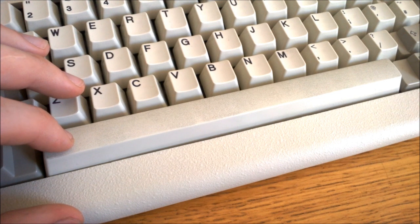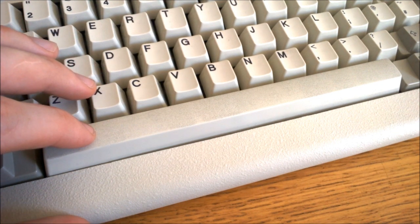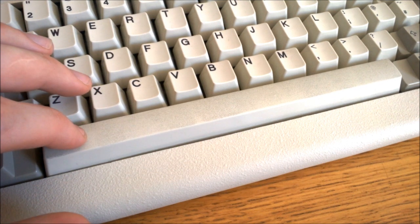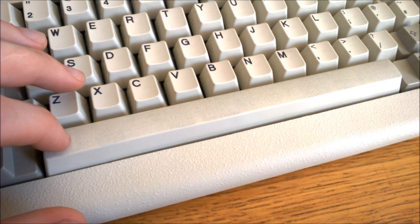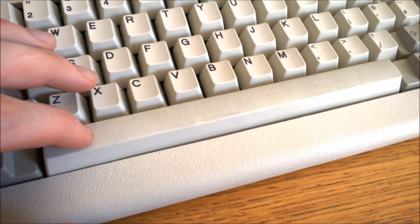One well-known issue with this keyboard is that the stabilizer on the spacebar, the only stabilizer in the board I might add, adds a lot of force needed to press the switch, so the spacebar is very stiff. You can bend it outwards a little to mitigate it, but I chose not to. I kinda like it with that quirk, gives the spacebar more of a presence.